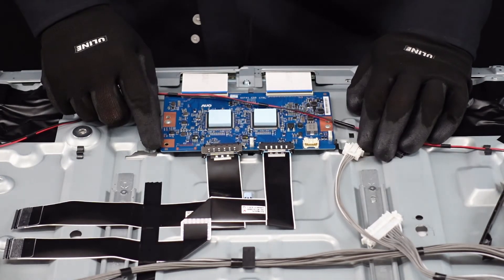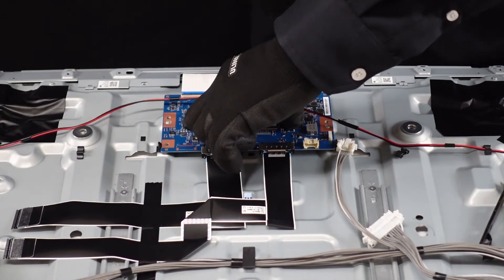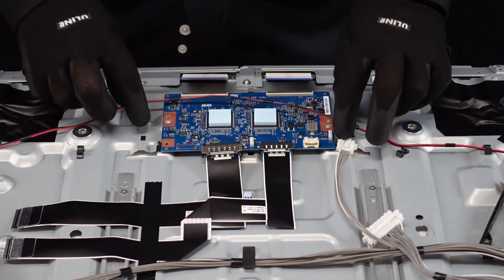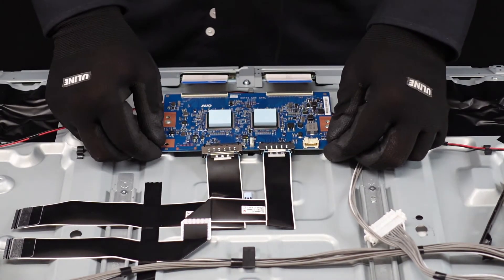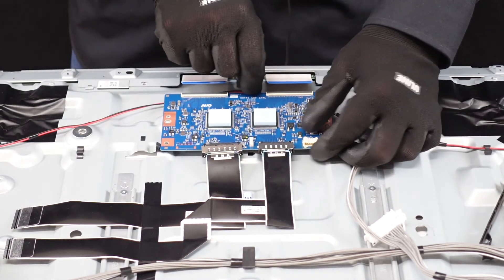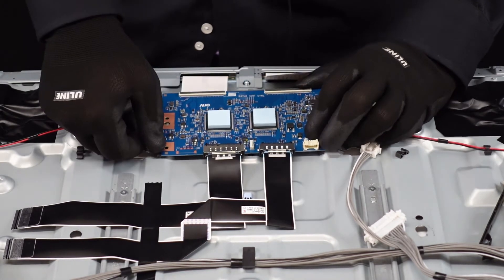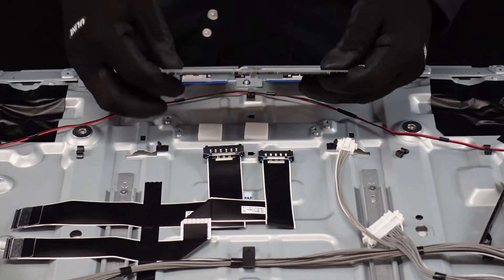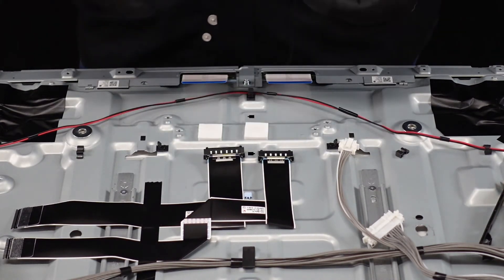We have access to the rest of the T-Con. Hold it into place while you lift up on these flaps, and then shimmy those ribbon cables directly out. At this point there are no more screws holding the T-Con, but there are some black tabs here, here, and here. Release two of them and the top part starts to lift up; then release the back one and start lifting up there. There is adhesive underneath, so pick either the two front tabs or the back one first and start lifting very gently — it shimmies directly out. There are two pieces holding it in place, and that is going to be your T-Con.